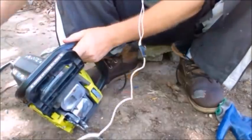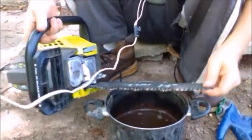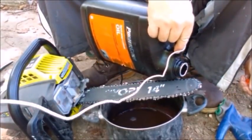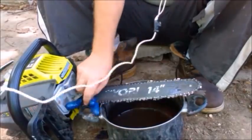Finally, pour a little bit of bar oil on the bar itself. Since we've just cleaned everything, all the oil that was on there has been removed, and we want to make sure it doesn't rust in storage. I learned this trick from my other grandpa — just wipe it down with a glove. Living off-grid, it's important that your equipment runs when you need it to. We've taken the extra steps to make sure that next fall, when it's time to start cutting again, we're ready to go. Thanks for watching!